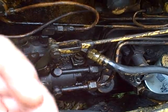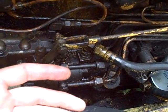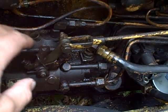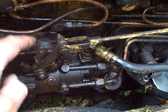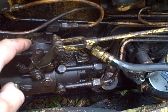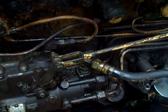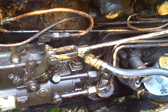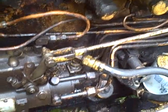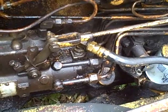The more that metering valve is open, the more fuel you get. After I saw how this worked, I realized that if something happened in there where the metering valve is not allowed to open enough, it's going to have the same effect as having the throttle all the way down. And if I've got a tired old engine with the throttle all the way down trying to start it, it would probably act exactly like it's acting right now — getting some smoke because some fuel is combusting, but not enough fuel to get it initially started.